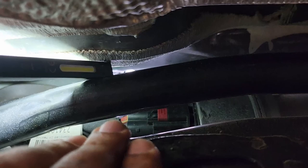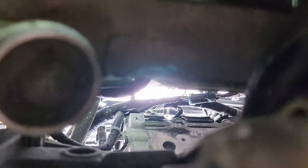The place of those two connectors is really inconvenient — there's metal in the way. I'm under the vehicle now; this is the flex pipe. The harness for power and ground to the motor is right here on the left side of the flex pipe. The other harness for the CAN network I cannot get to from this side because the rack and the subframe are in the way.